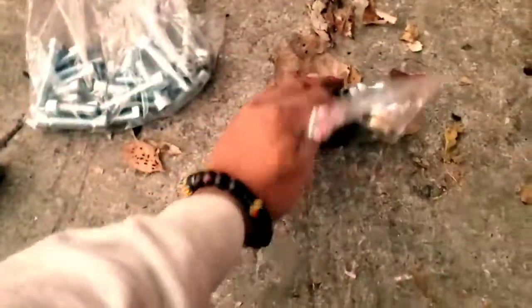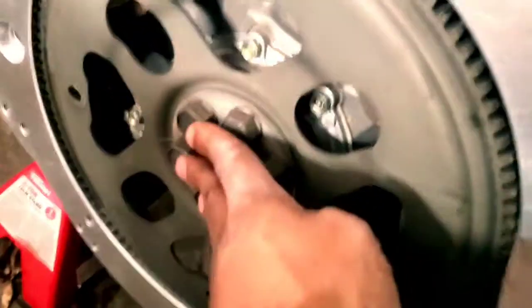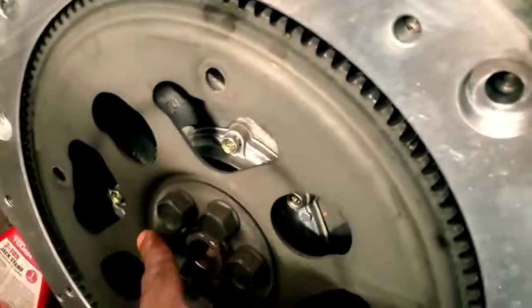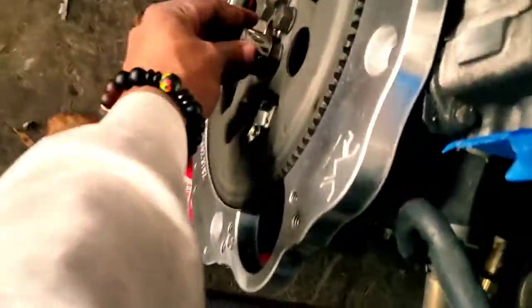Here is the hardware that comes with this kit. There's the bearing that goes right there — it's going to be different so you'll have to use the included one. It also comes with all the housing bolts, the flywheel bolts, and the transmission bolts. Next step: pop off the old flywheel bolts and pop out this bearing. The flywheel bolts directly to the crank plate — the included bolts look like they might be a little longer than the stock ones. They look like maybe a 19 or 20mm — pop those off and get the plate out so you can get that bearing out.